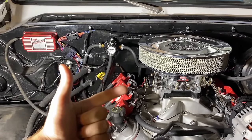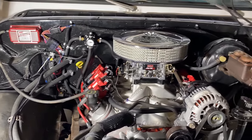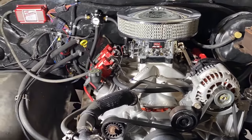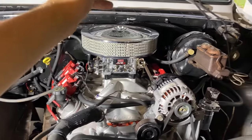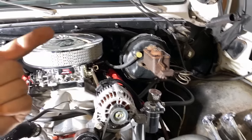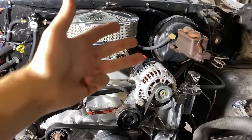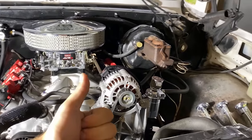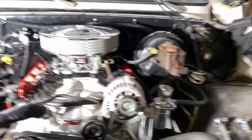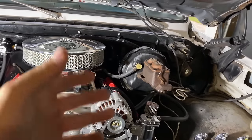They give you all the harnesses to go to your cam sensor, crank sensor, and coil pack sensors. They tell you whether you have a 24-tooth or 58-tooth reluctor wheel and which sensor to use. Then you have some wires that run inside: your tach wire, two-step wire, launch retard timing wire, and keyed ignition wire. The launch, two-step, and retard wires need 12 volts applied to activate — I did not know that, and nobody explained it.